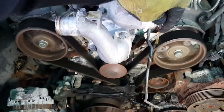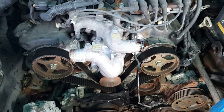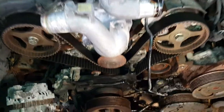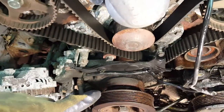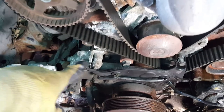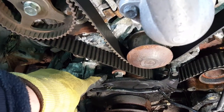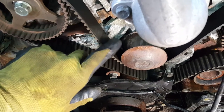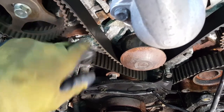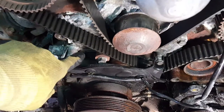It's not the engine. It's not the crankshaft. It's another thing. The reason that noise is coming from is because that particular part right here - that's the pressure tensioner for the belt. As you can see, the belt is loose. It's not tight. That belt is not good.